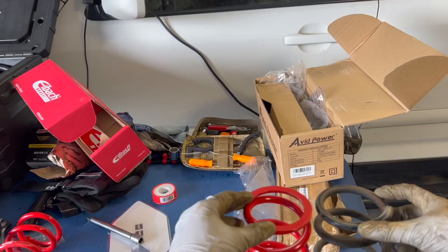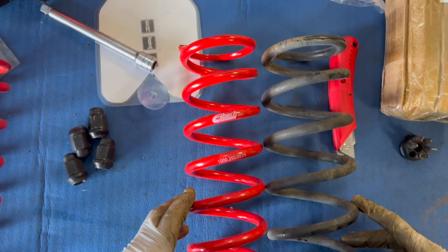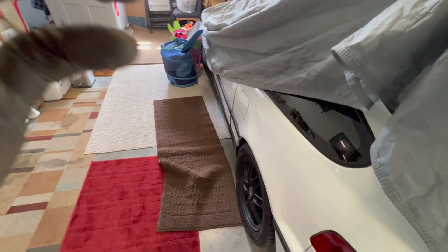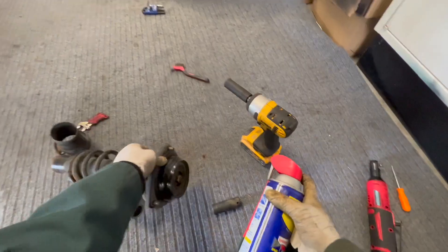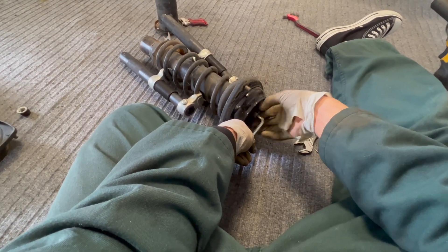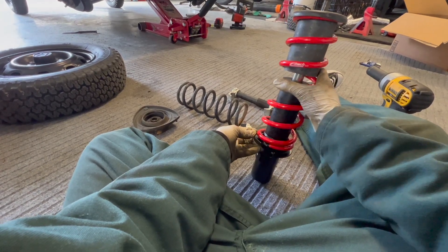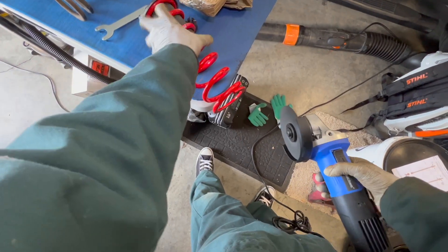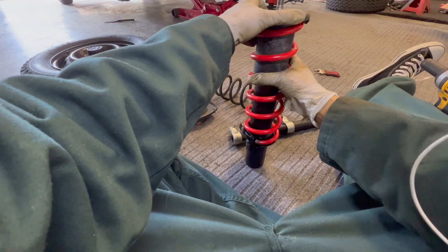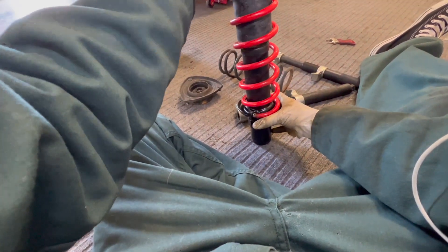I have a pair of these springs at the same size. Looks to be a little bit more narrow on the eye box. This will be for my CRX — that'll be another episode. Top cap on here. You can see on the bottom it looks like it's not sitting very well, so I think I'm gonna cut. As you can see here, it looks like it's sitting in there a lot better than before. Half a ring off — that should be good. I was told that it works just fine with half a ring off.